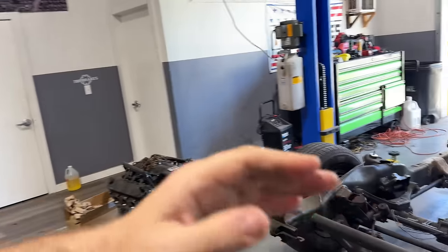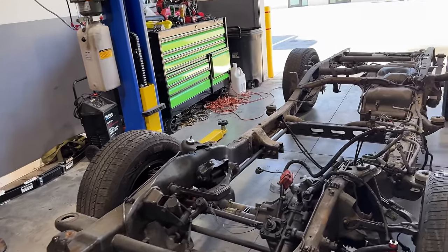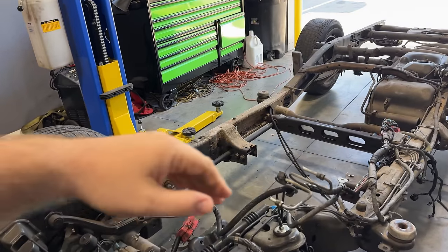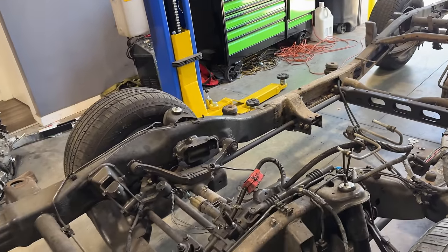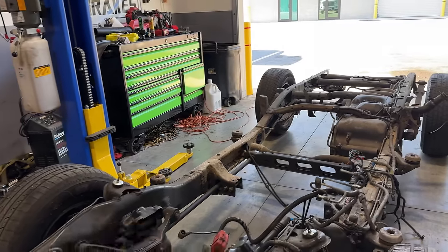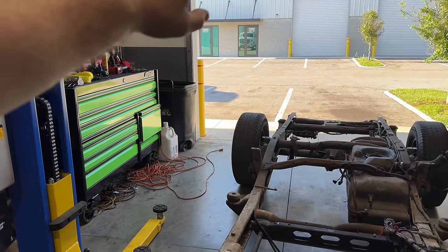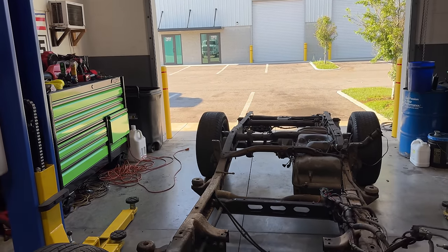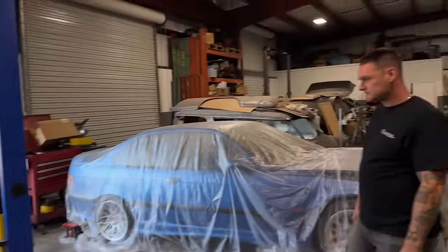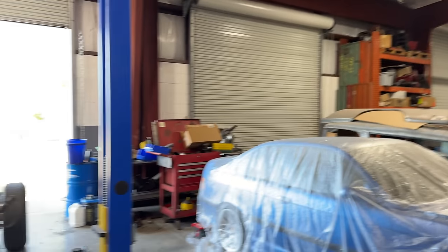So today I plan on stripping everything out that we're not going to use. Mississippi Queen is all manual brakes, so all the ABS, all the brake lines have been taken out. I have zero of the factory wiring in that truck. Everything runs off the Holley. Obviously we have a fuel cell in it, so the fuel tank can go away. And half the cross members back there we're going to cut out. So I'm going to make it, within reason, as light as possible, without having to have my man over here come behind me and weld a bunch of stuff in.